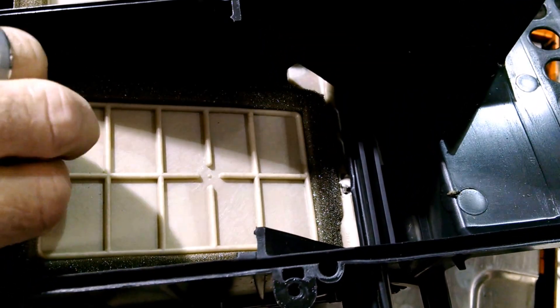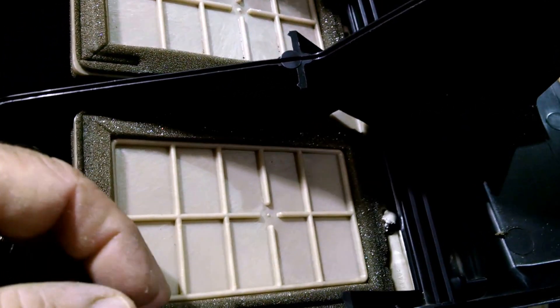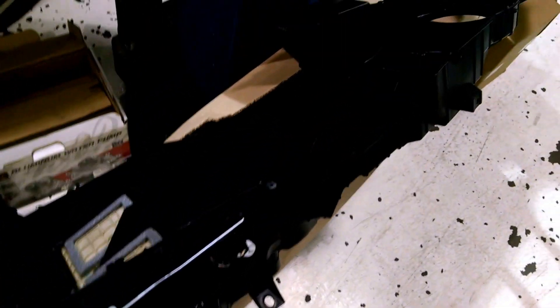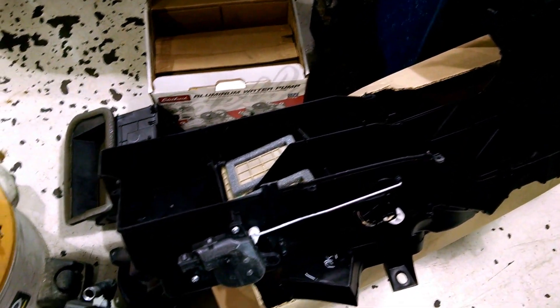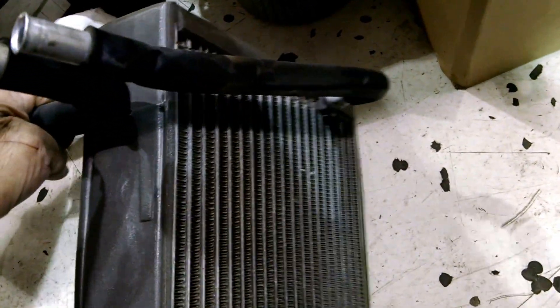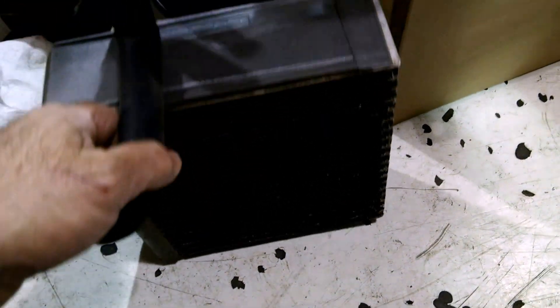To repair this, unfortunately you need to take these cases apart. This in itself is a pretty simple fix. This one is actually going to get a new case assembly, which is this unit here. The customer has chosen — given the vehicle has over 100,000 miles — to go ahead and replace the evaporator core, which is the air conditioning part. Because it is already out, there's no extra labor; it's just the cost of the part, versus having to do all the labor again at a later date.